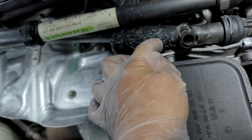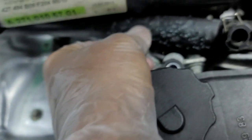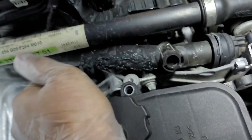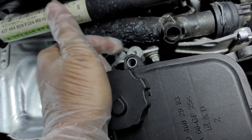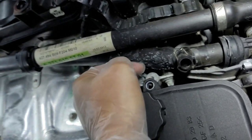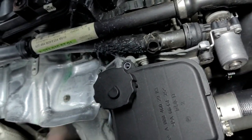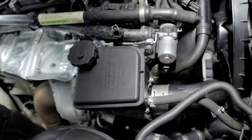When I noticed the crack I decided to try putting some putty - some rubberized plastic putty. I let it sit overnight then drove to work and it started smoking. It wasn't a good idea because it was backfiring from all the coolant, and when it got too hot the rubberized sealant was causing it to smoke. There was also the possibility that the coolant was getting somewhere else and creating smoke.